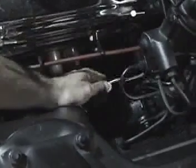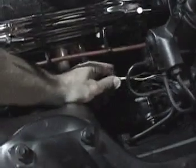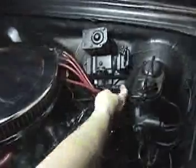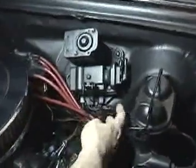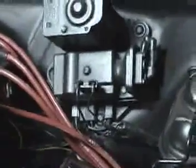If you look back here, you'll see we have a couple other wires here that we have no idea what they are. This is the type of stuff that we're going to avoid with our new classic update kit. All this type of stuff is going to go away. All these repairs that you've got back here, we've got a whole lot of cutting and splicing and cracked wires here on our windshield wiper circuit and all this electrical tape. Something's going on underneath there that's not supposed to be done. So that's something else we're going to take a look at.